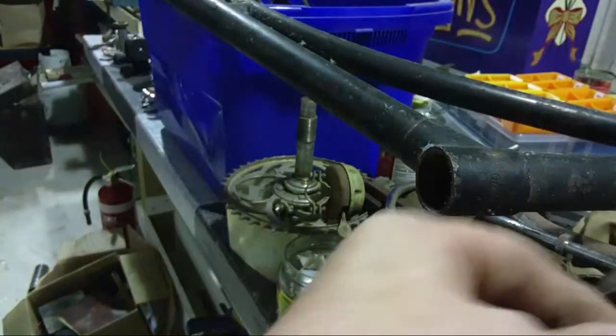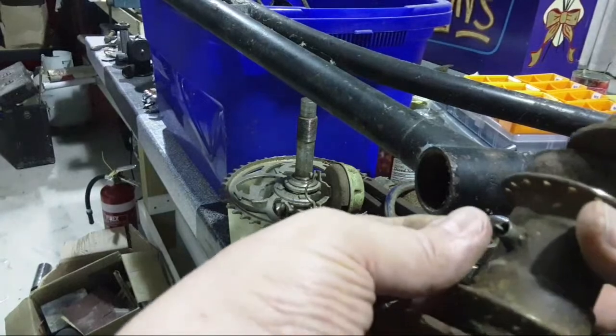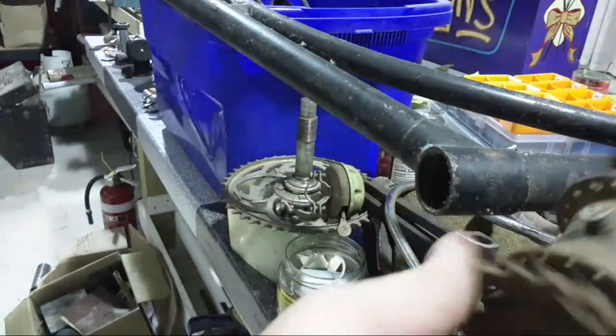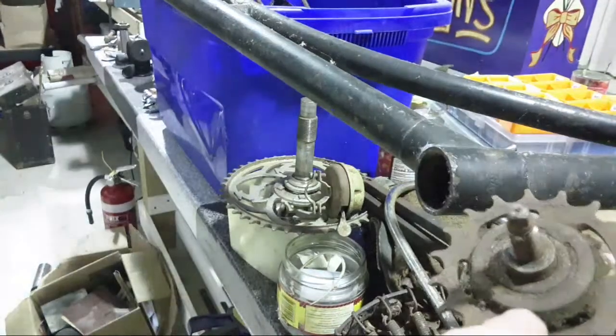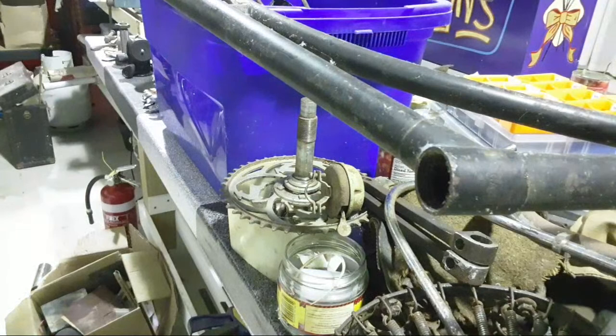All these brakes and everything have proper oil caps with the click over tops. This is the rear sprocket, which is pretty worn actually. We're going to have to find another sprocket for that at some point. So it's another challenge, and whether we can get the right pitch chain's another thing. I think we need to, because of that front sprocket, because I want to keep that.